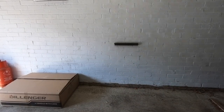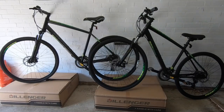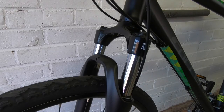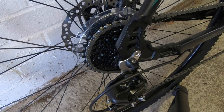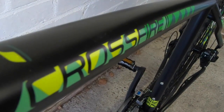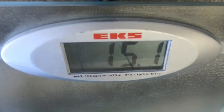So let's talk about the bikes that we bought. These are Carrera Crossfire 2 Hybrid bikes. They retail at £330 from Halfords, but we bought them on sale for £260 each. They have an aluminium frame, front suspension, disc brakes — which is very important because we're going to be pulling more speed, so we need to be able to stop — and 24 gears: three on the front and eight on the back. We've got a 21-inch frame for me and a 19-inch man's bike for Zoe. Why a man's bike? Simply because of the location of where we're going to put the battery — there was not enough room on the woman's bike.